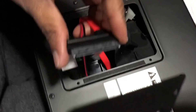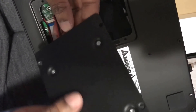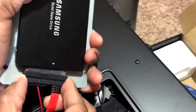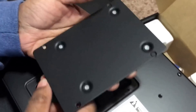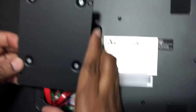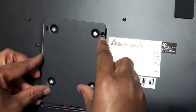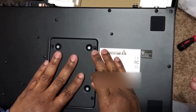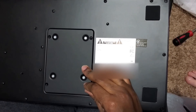We've got a little cable here, and we've got the connector — plug it in. It may be a little tight and that's on purpose so it can snap in good. Make sure it's in there firm, and again you want to make sure that cable is pointing down — just kind of work it in there. Be gentle but don't be scared. Because the cable is stiff, it may want to push the door out, so you might have to put a little pressure on the door to keep it closed while you seal the back.